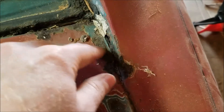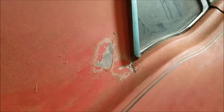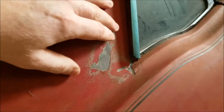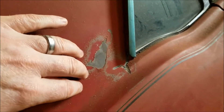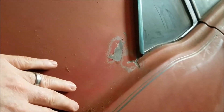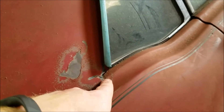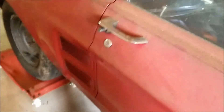There's some pitting in this piece here where the paint chipped off, but I should be able to take care of that pretty well. Right here — and I've got this all over the car — there are spots where the bare metal is showing but not rusting, which tells me that somebody used some sort of acid-based dip or something when they cleaned this off, or maybe that OSPHO stuff, and they never cleaned it off in certain spots. The bare metal is there and not rusting, except for down here it's obviously got some rust going on. The drip rails are in good shape all the way around, which is one of the reasons I got the car.